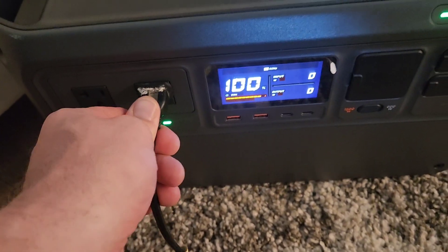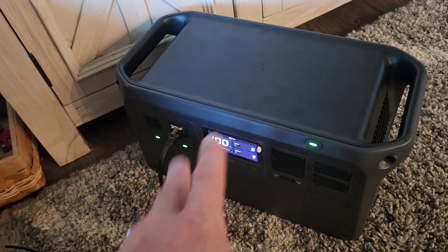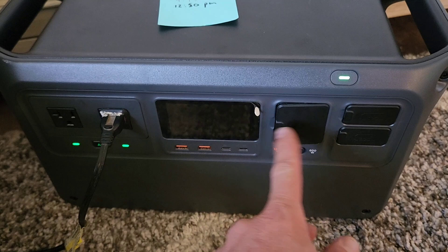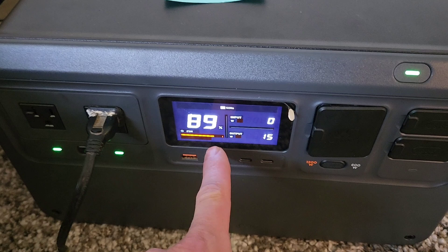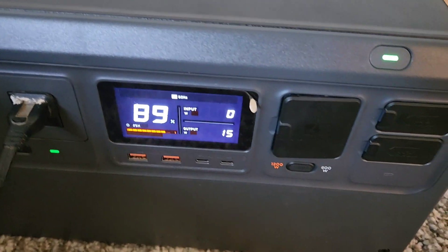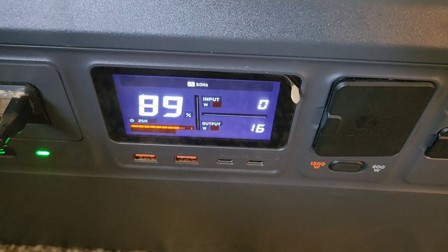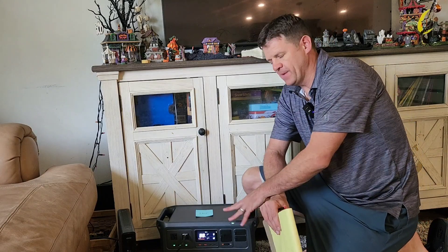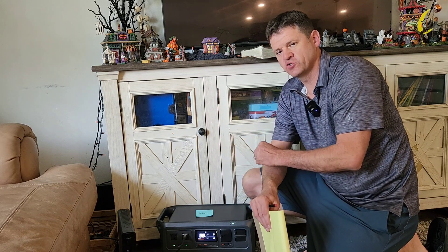It's 9:45 — let's see how long it lasts. Over the last month I have been using this as a UPS for my Wi-Fi router, so basically when I'm testing things in my house and turning off power, my Wi-Fi router will never lose power. It's been about three hours and ten minutes and we used 11%. At the three-hour mark we are at 90%, so we used 10% of our power. Right now it's using 15 watts. I want to find out how much time it will take to use 100% of the battery without waiting that long, so I should be able to use ratios to figure that out.